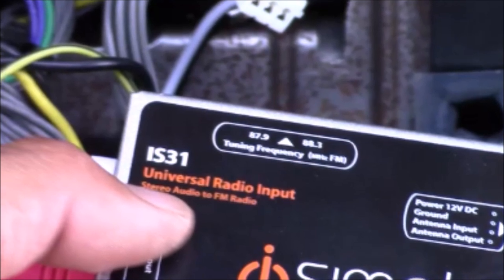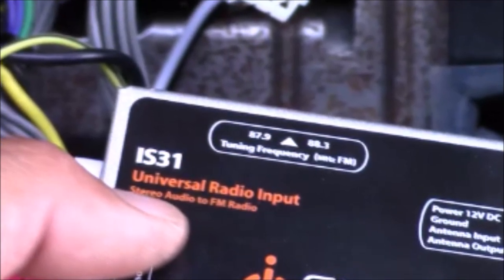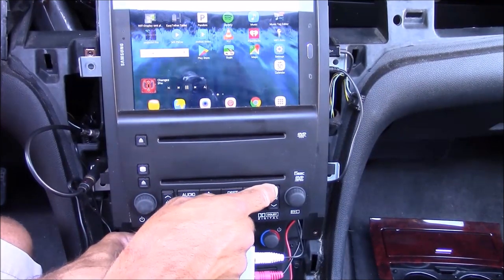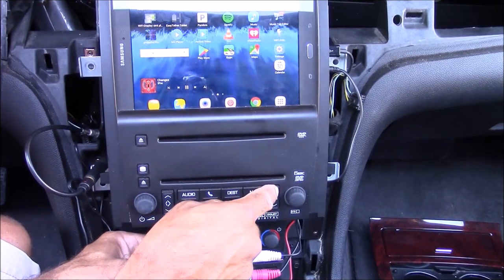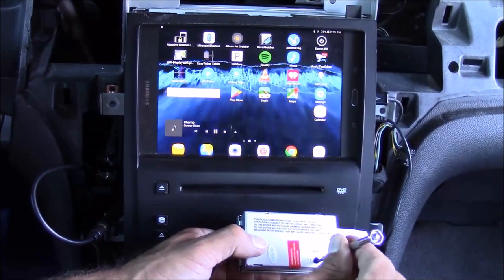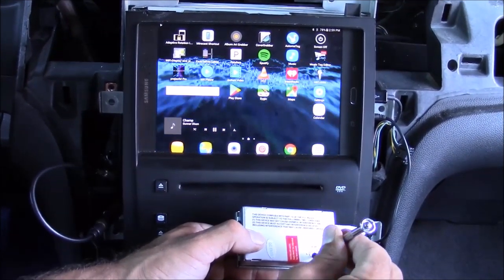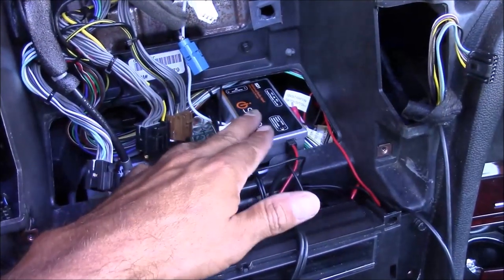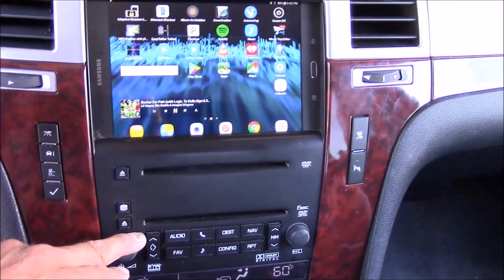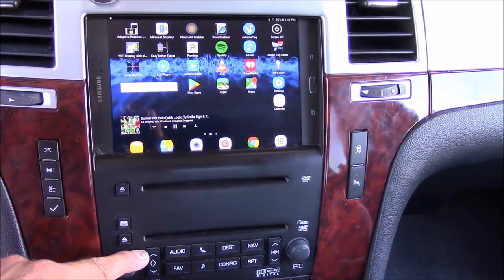All my wires are hooked up, so it's time to plug in my car stereo, reconnect the car battery, and test this out. For an auxiliary device I'm actually going to be using a tablet. The modulator is set to 87.9, so I tune my FM radio to 87.9 and I should hear audio from my tablet. It's all tuned in now and it sounds pretty good, so I'm not going to mess with the frequency. If you want to adjust the level gain, you can turn it down with a small flat blade screwdriver. I've got all my settings where I want them, so now I'm going to tuck my FM modulator behind the dash and secure it with double-sided tape and put everything back together. Thanks for watching — this is CLS111. If you want to hear more from me, please like and subscribe.